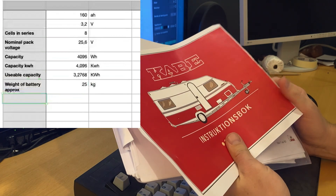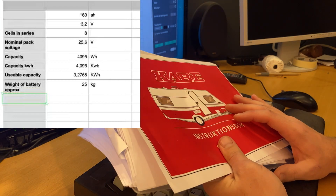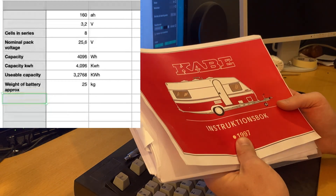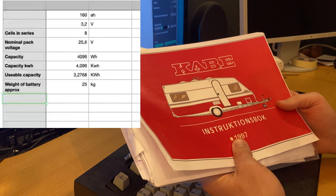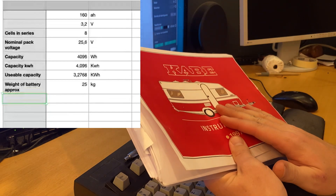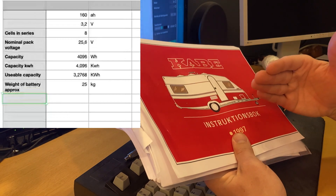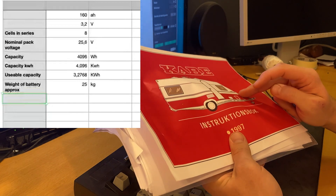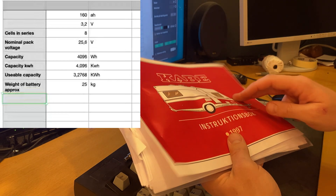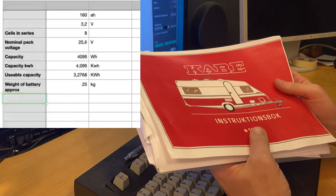This should reduce the amount of gas needed. Instead of having two flasks, you could probably get by with just one if you make sure it's topped up when setting out. This caravan is rated to load 250 kilograms above its service weight - but the gas containers, for example, aren't included in service weight. Two of those is already 40 kilograms, bringing you down to 210 kilograms of load capacity, and it adds up quickly.